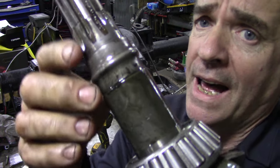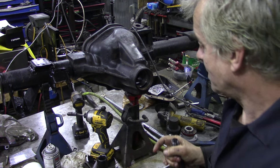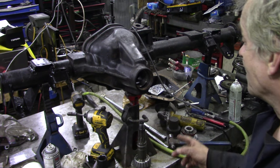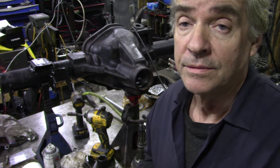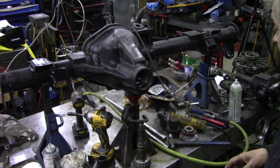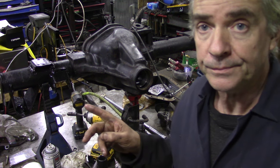When we look at this one it's still not so bad — pretty good actually, we could use it again. But look for shininess on the bearings; if they're shiny we'll just leave them. I'm thinking I might as well change the lot — there are only four bearings in the axle. I think what's happened is it's picked up rust in this axle, got mixed up with the oil and started to pit things. On the Spanish 110, one of the bearings had actually started to collapse.